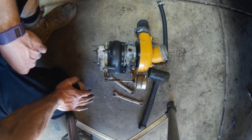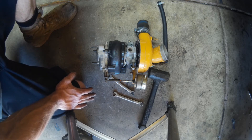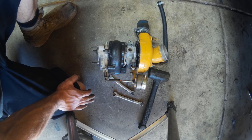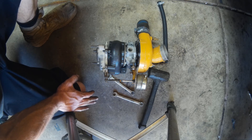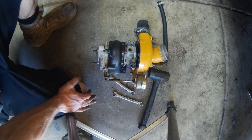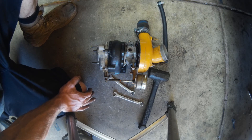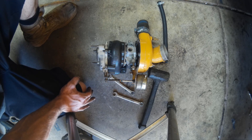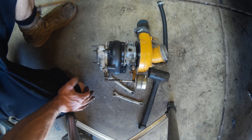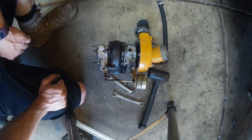It really is as simple as that, guys. The stigma of difficulty around turbochargers can be broken through basic education and a little common sense. There are effectively eleven bolts required to swap a housing on a Garrett T3 base turbo — five bolts for the swing valve and six bolts that hold the turbine housing to the center section. Don't be afraid of it. The main thing to watch out for: be really gentle if removing a housing that's been on the turbo a long time, because if you get aggressive with a hammer, the turbine wheel can hit the housing and be damaged. Other than that — if you liked this video, give it a thumbs up, hit subscribe, and I'll see you in the next one.